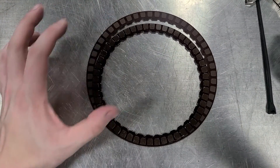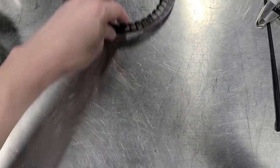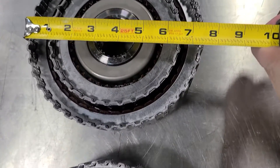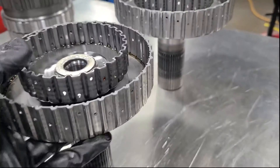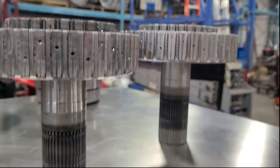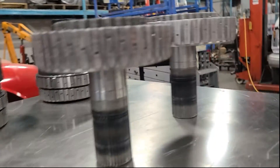There's quite a bit more surface area between the two — that's part of why the turbo transmission can handle a lot more input torque than the NA. Measuring the actual difference on the drums: we'll call that six and three-quarter inches to be generous versus seven and a half inches. These are the input hubs that go on the back side of those clutches. Just everything's bigger to fit, with the other hubs a little different in height because of the overall length differences of the gear train inside the trans.